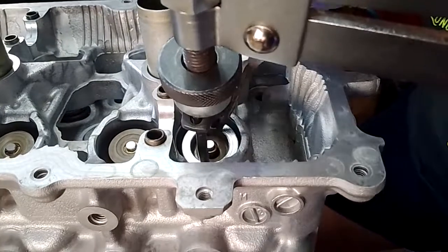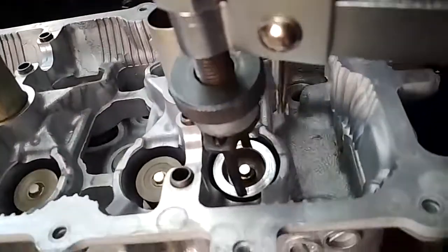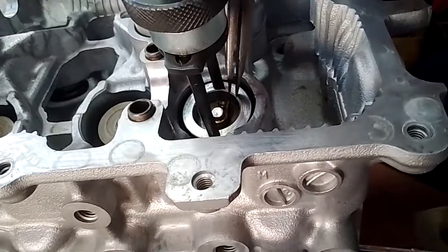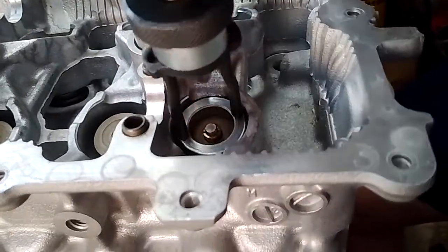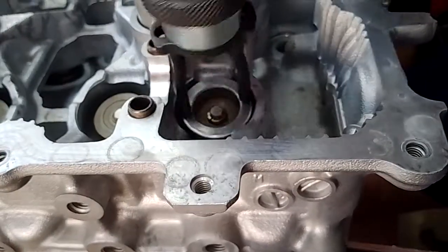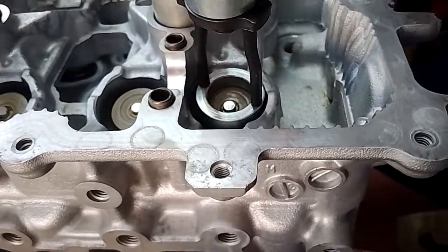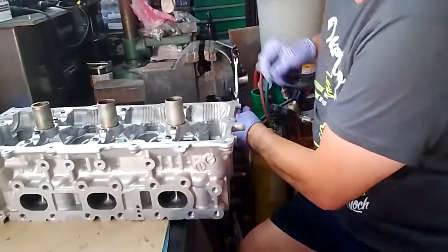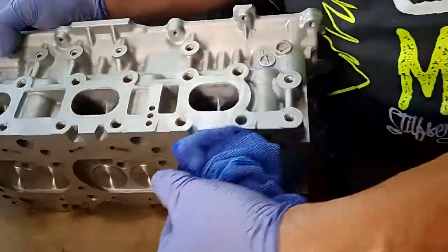The reason I'm spinning it around is I personally find it easier to fit from this side - if you're a lefty you might do it the opposite way. Next collet - you fiddly little blighter. Typical, doesn't drop in first time. There we go, excellent! That little bit of assembly lube in there is helping to hold it in place. If you do it totally dry they slide out and you're forever picking them up. Okay, I can back that off and remove the compressor. That looks fine - give it a tap with a hammer just to make sure it's all seated, and it is.